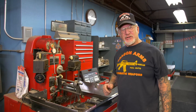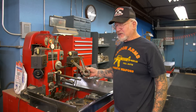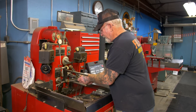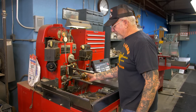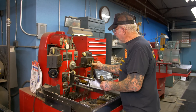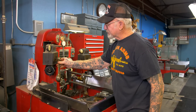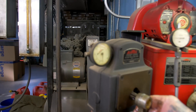You're probably wondering what this machine does — every machine in my shop has a purpose. This one rebuilds and hones out connecting rods. It hones out the bushing, the main race. You put your mandrel in there with a stone on it, step on the pedal, and it goes back and forth taking out a little more metal at a time — the hole is getting larger. To measure, these are dial indicators that tell me when I get to the right size. The same thing with the wrist pin bushings — this measures them. See, that one's done: zero at the highest point.